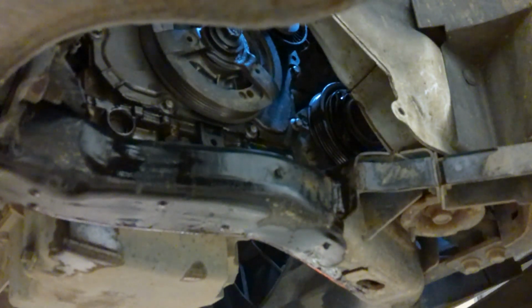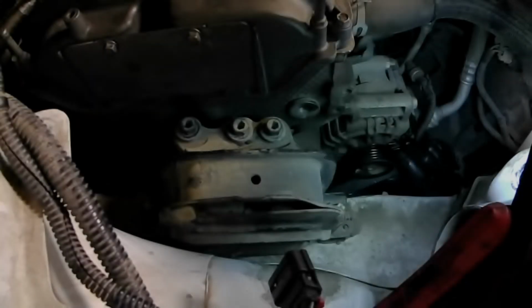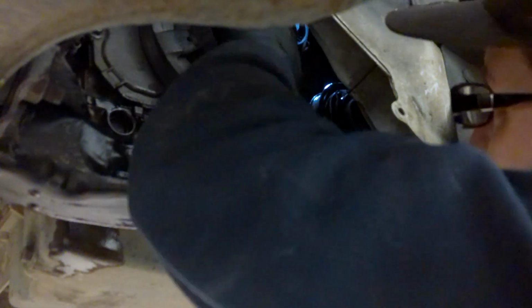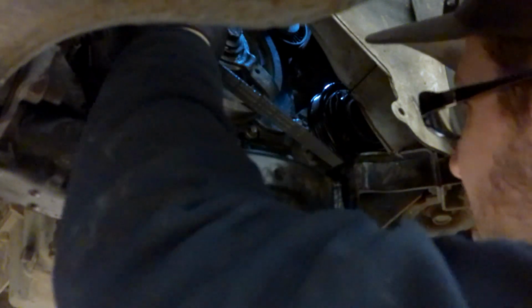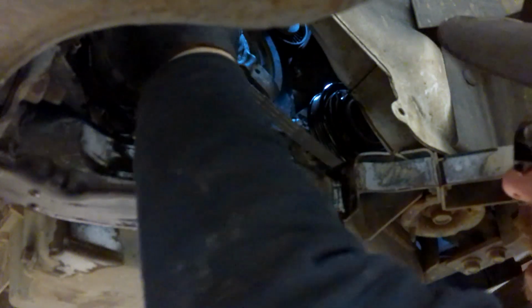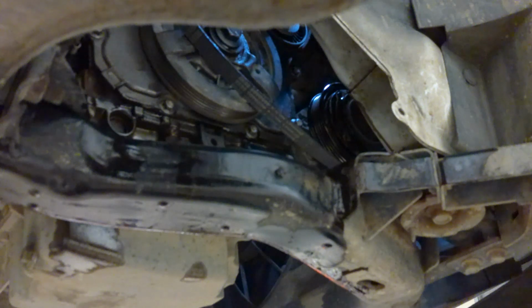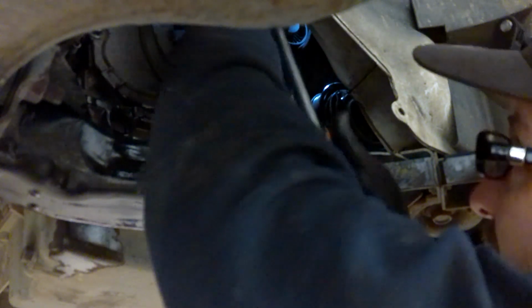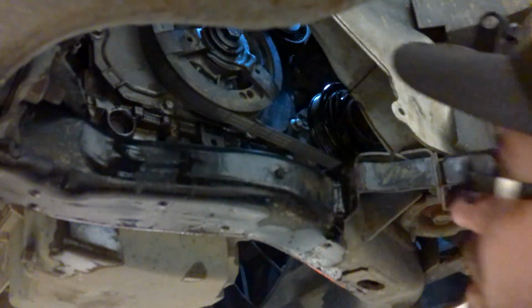Here. Now we grab the belt. Put it on the same way it came off. Feed it to your other hand that goes through the frame rail. Turn it sideways. Put it behind the tensioner. Around there, around there. Grab the 3/8 ratchet without a socket on it. And put her in right there. Reverse. And the belt's on.